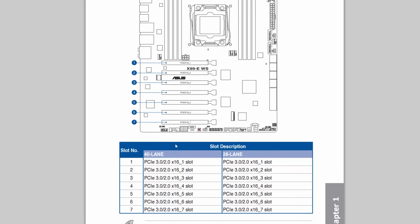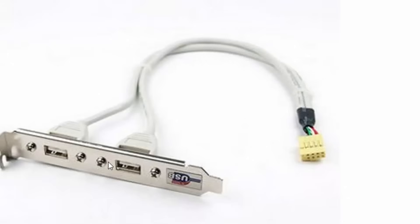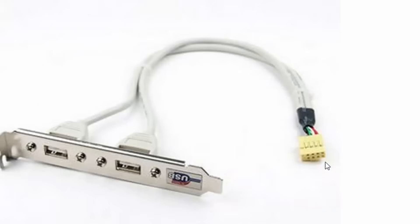You also must understand the hardware you have purchased or are using. For example, know what version of PCI buses you have — it's very important. If you have one version of PCI Express on the motherboard and a video card with a different version, it may slow that video card down. Many times on a motherboard there are pinouts for functions such as USB, USB 3.0, COM, parallel, and various audio, and you have to bring those pins to some external device. These bracket adapters fit in the rear slot and bring USB connectors — many times these go to the front panel or rear of the case.